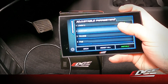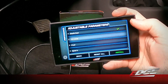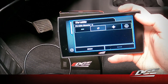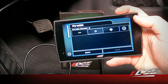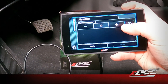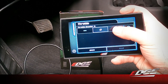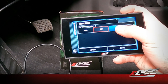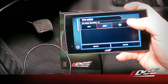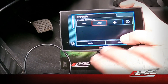We'll go ahead and tell it to remember all of the available modes. One of the really nice features that a lot of guys love is the ability to adjust your throttle sensitivity. These trucks have a lot of built-in pedal lag — a delay before you actually start feeling it accelerate. We can actually change that delay to make the pedal much more responsive for a nicer driving experience in stop-and-go traffic or when towing. You can set this anywhere between 0 and 50 percent over stock. Personally, a 20 to 25 percent pedal sensitivity offers great responsiveness without being so touchy that it's hard to drive or jerky when towing.